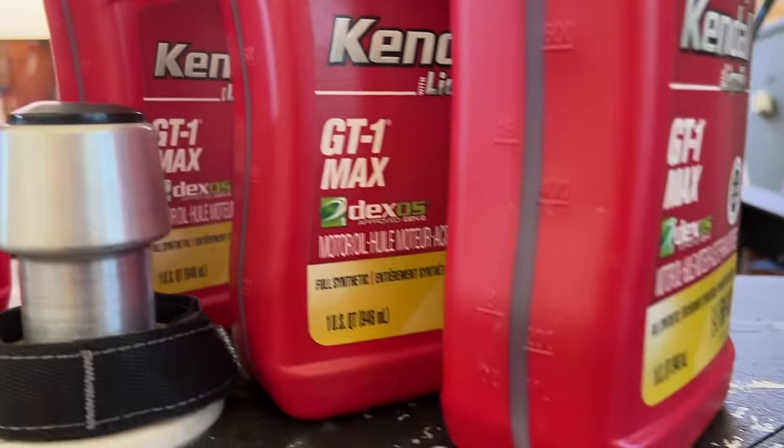This is a knock sensor out of this side of the engine — you can see it's in really bad shape and the block is the same way. Because these don't run coolant in them, they tend to get rusty, especially if you let them sit with water in them without pulling the plugs out. I bought a tap — I'm just going to clean up those threads on both sides, then Emily can throw the plugs in it, put the hoses back on, and that's it. Then we go get our life jackets, our anchor, our tie-downs, all that stuff, and we can launch this thing and go out for a ride. I'm really ready for that — it's quite steamy outside.